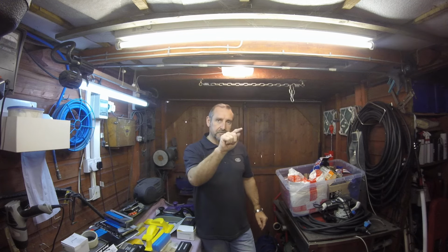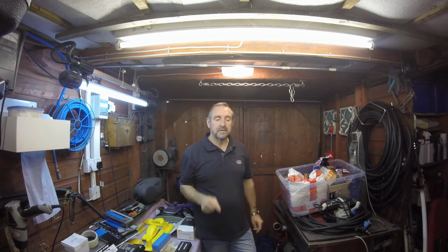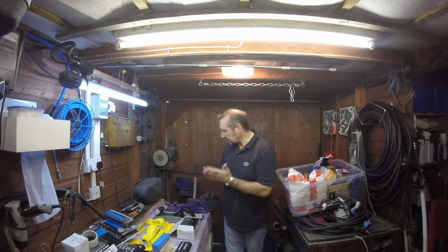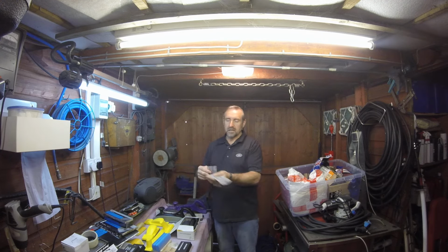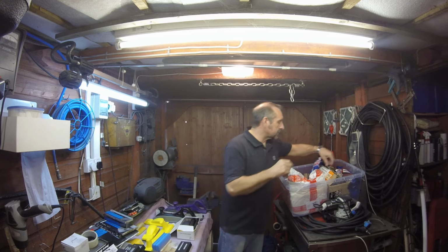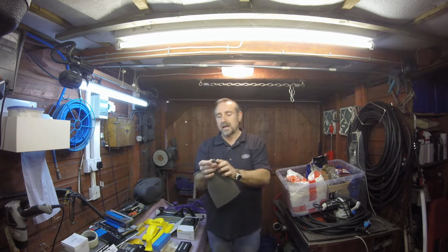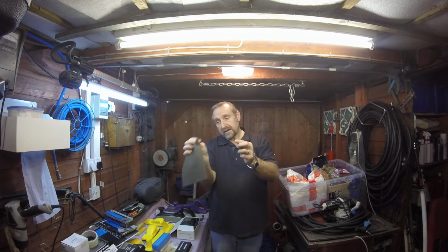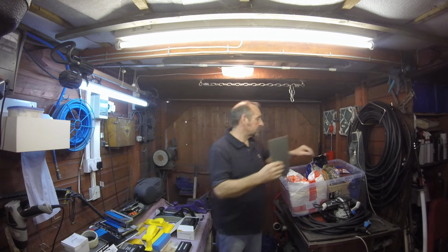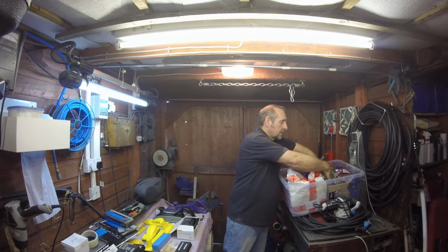There's normally a little sort of 5mm recess taking the shape into the steelwork, into the panel, or around the door handle. You can't get a pad in there that's fixed. A hard pad, something like this, would be no use to get in there. So you need to have something that you can, let's say, wobble up in your fingers, and just scrub away around the edge, just to create some adhesion right round into the backside where your door handle would fit. So the Scotch pads are great for that.